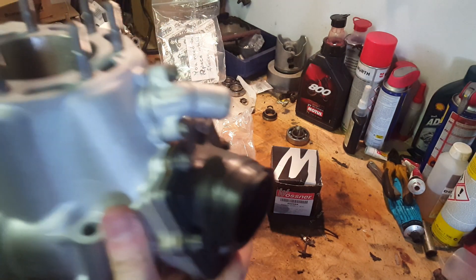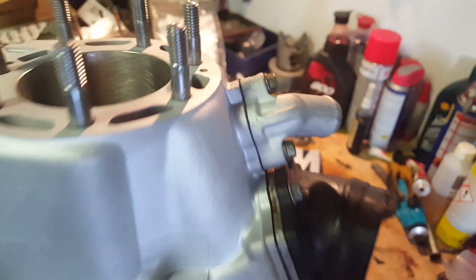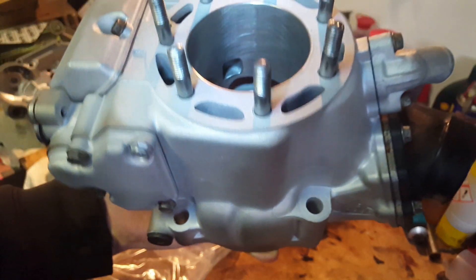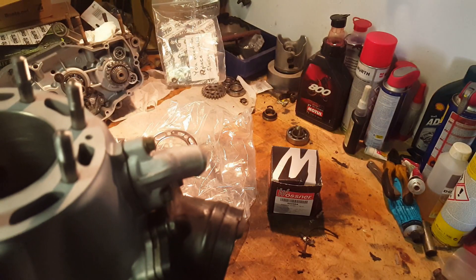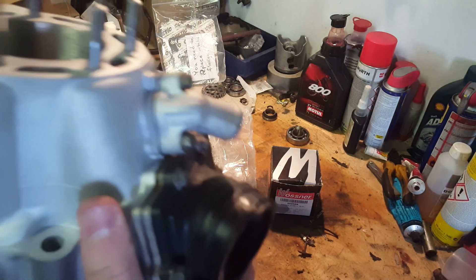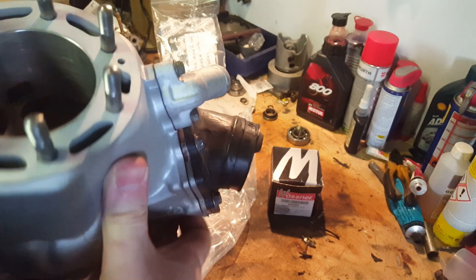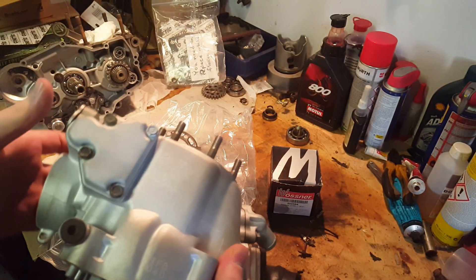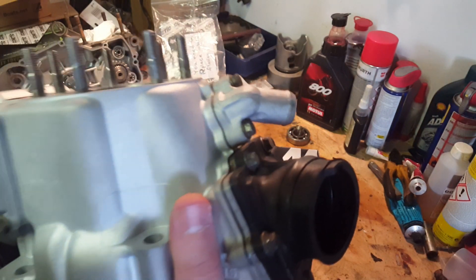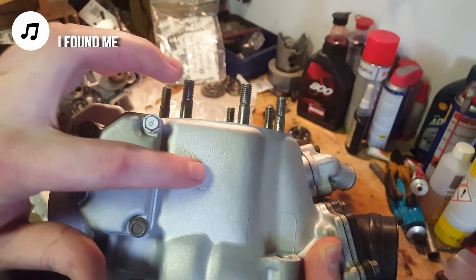That price was also for this piston here and for those gaskets in the box. The inside looks perfect and there are no marks after the scuffing that was there before. I ordered it to have the bore made for the piston, so they use the piston as the sort of base for the size of the bore in the cylinder. I also chose to have the power valve serviced by Millennium Tech — they offer it for like sixty dollars.